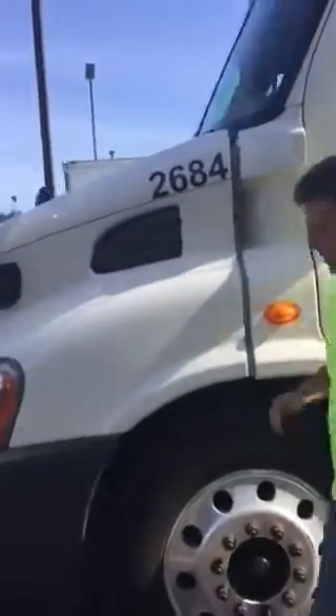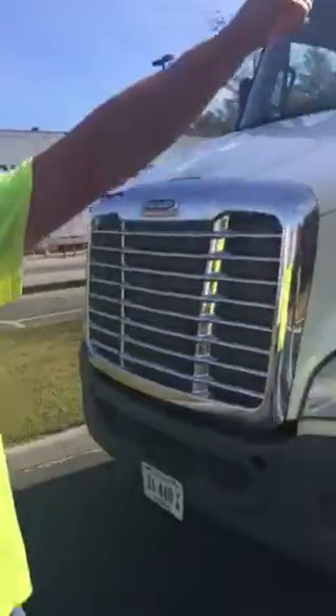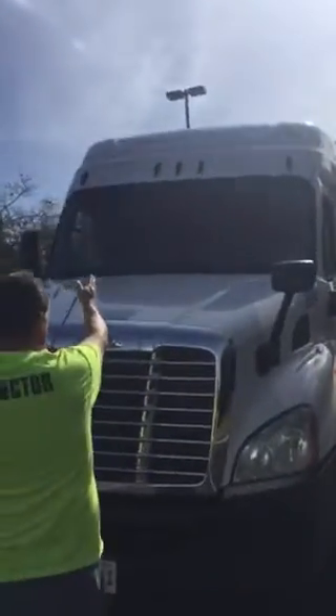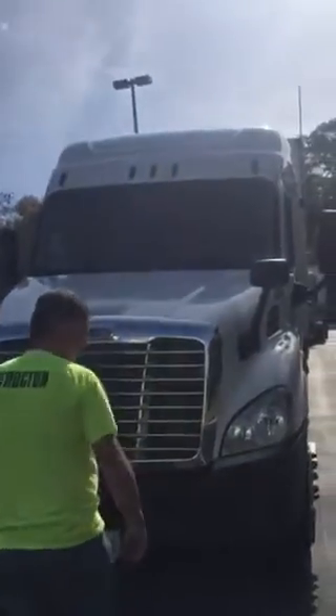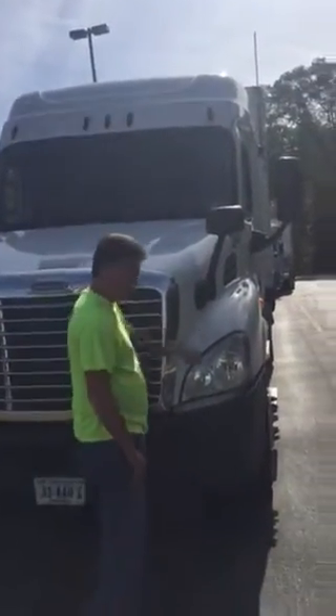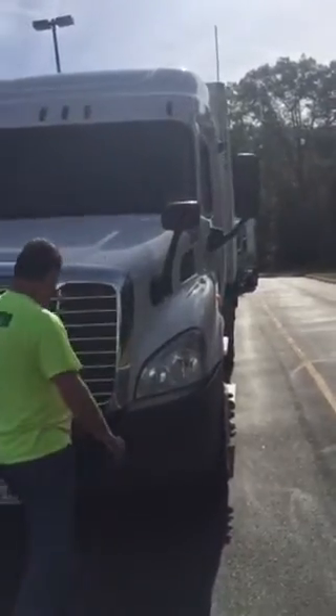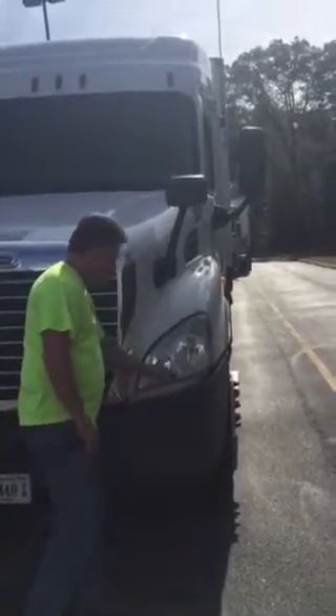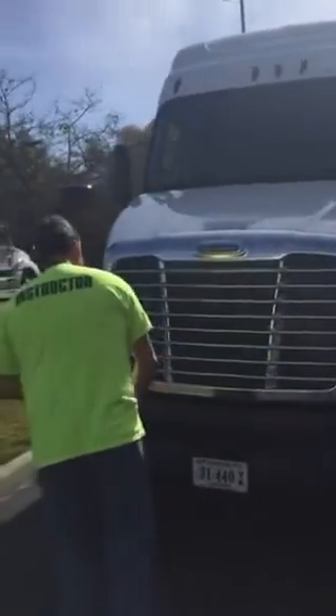At the front of the vehicle, we're going to start with our trailer clearance lights, our tractor clearance lights, our tractor ID lights, and our tractor turn signals. They're not bent, cracked, or broken, missing nuts, bolts, or screws. They're amber in color. Then we're going to move to our headlights — our headlights are not chipped or cracked, they're clean and clear, and there's no signs of condensation, which would indicate a leak.